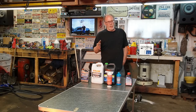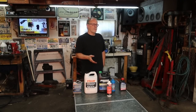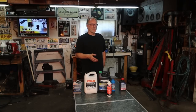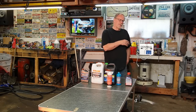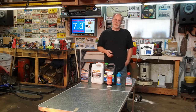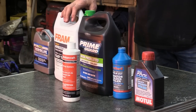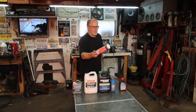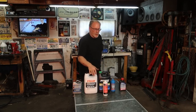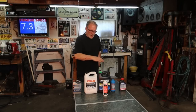So go ahead and, like I said, flush it out with your hose, but when you get done, make yourself up some type of siphoning system or whatever the case may be, and run distilled water through everything. Get everything completely flushed out. Then go through and fill up 50% of your radiator system, your cooling system, with the green. Pour two of these in. Top it on off. Run it. Burp it. That way you're all set.